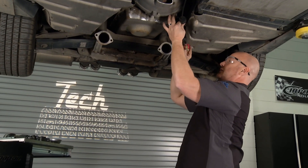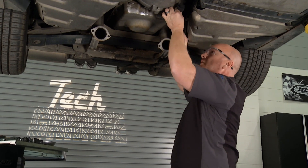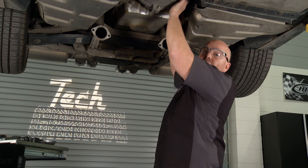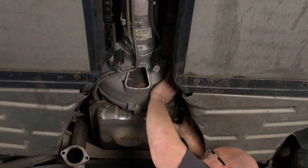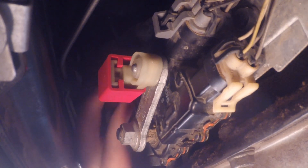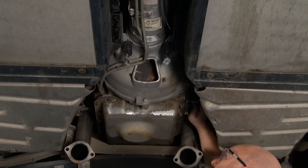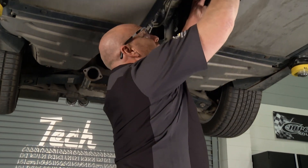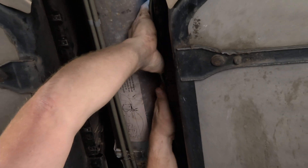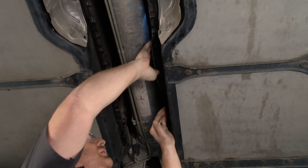I like to work from the front to the back — that's going to be your friend when seating that rear bracket. Got access there. Now at the back you can see the new linkage and the safety connector which holds that ball in place. Bracket upright headed north, get the bushing in here, slide the shift linkage back — John left it in neutral so we'll be close when we seat it. Now slide the safety tab back, pull the lock hasp up, red tab back in, lock it down. Shift linkage is back in — not that bad, just take your time.